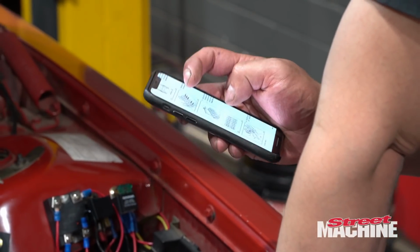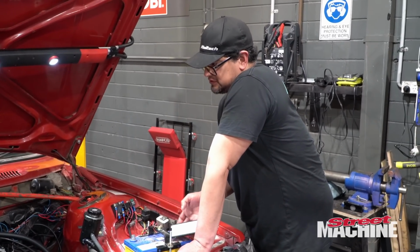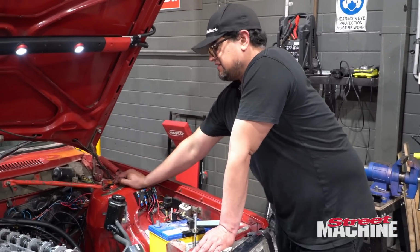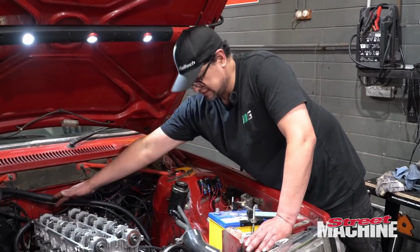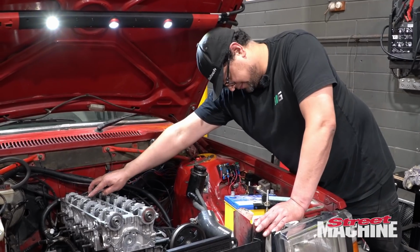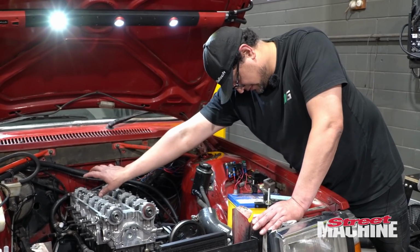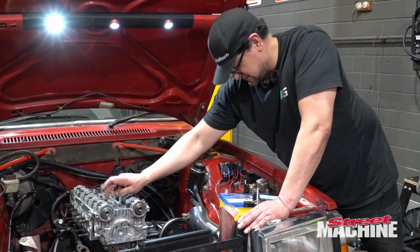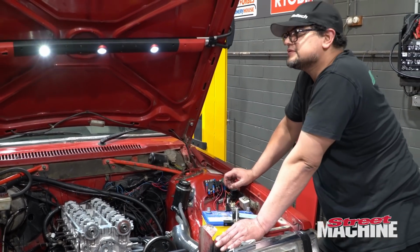Yeah, there's a sequence here, just like when you do head studs. The sequence I saw was third one, in out or out in? We had it on our thing. They're fairly even anyway. So it's third cap, 7th cap. Then 5th, 4th. I'm playing piano here. We got 6th. And then 2nd and 1st.